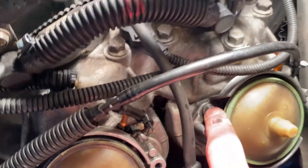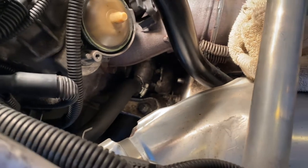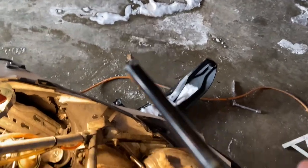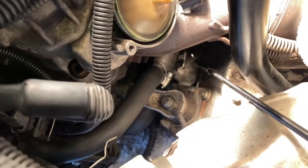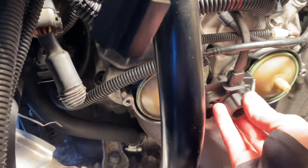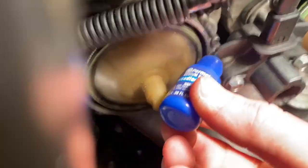After you get your hex bolts in and your hoses back on, you're going to want to take your sensor and put it in now. As you may have just seen, that's what you don't want to do — just drop a bolt down in there. You can see it sitting right there. I want to invest in one of those little tools with a grabbing thing on the end — it makes fishing things out of your engine a lot easier. Anyway, your sensor goes back in. Try not to drop your bolts down the engine. Get them started and put your Loctite on the back.